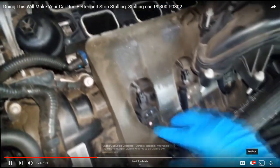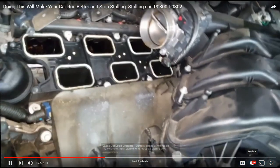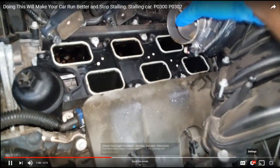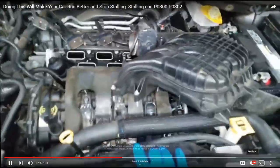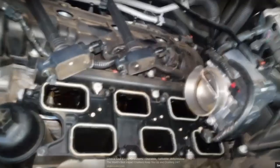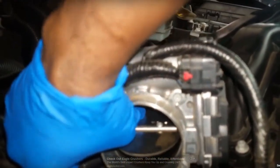Because actually I'm replacing the coil — I had a misfire on cylinder six. As you can see, that's a brand new coil. That's a secondary misfire — you can tell the difference because a secondary misfire is going to show on load, so when you bog it down you might be doing a lot of shaking. But I want to stay on topic: the perfect time to clean your throttle body is during a tune-up. What I have here is a toothbrush — a small toothbrush — and what we're trying to do is clean all the carbon build-up off this thing.